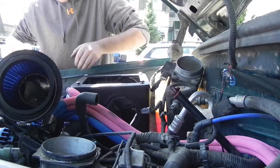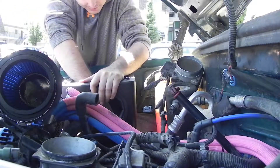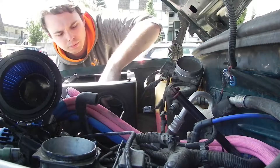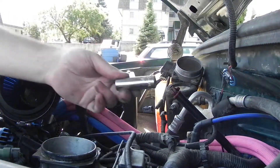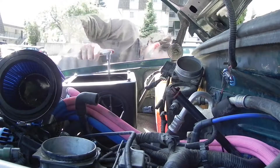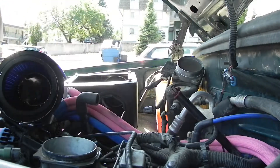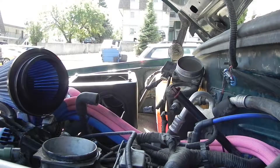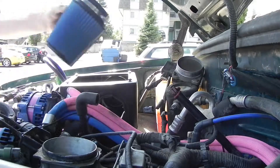After I got the wiring moved, you can see it now fits in there nicely — set right in, pressed up against the stock hole in the fender, running behind the passenger light for the air intake. I popped those bolts into the two holes drilled in the bottom of the new air box, which line up with the existing holes in your fender for the stock one. Everything lined up perfectly. I believe the bolts were 15mm, though I could be wrong. After separating the two rusted bolts, they turned out to be 8mm.